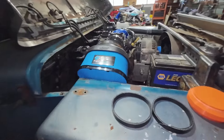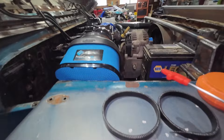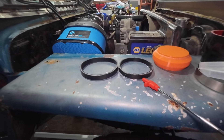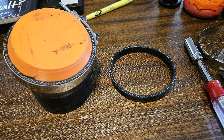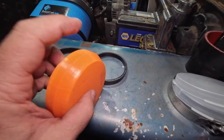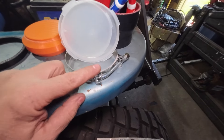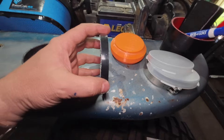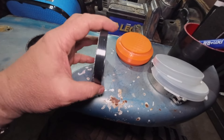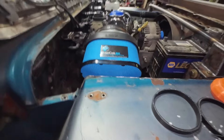The best way to trim it — I'll try to insert a picture here — is basically to clamp it around something round that you happen to have. This was the press tool for part of the gas tank pump mount, but the diameter was just about perfect. I was able to clamp firmly around that with one of the nice straight-edged T-bar clamps and use that to get a pretty decent straight cut on either side. Had to be a little shorter, but that wasn't too bad.